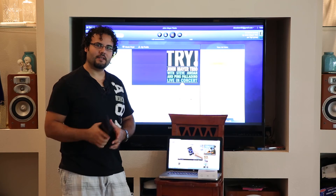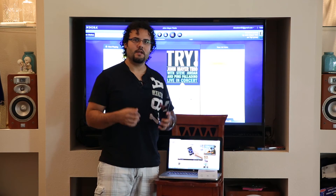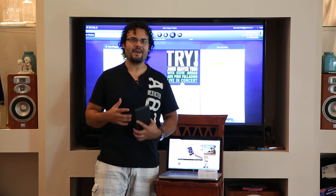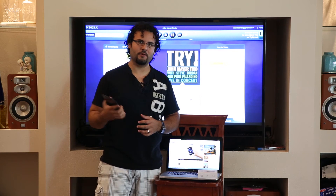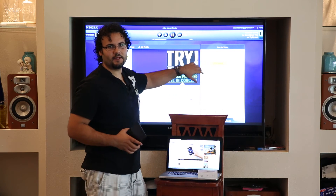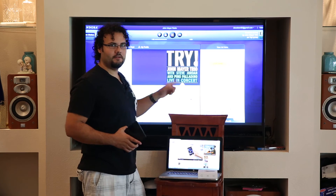Google brands the tab streaming as a beta, and it definitely is — I'd actually call it more of an alpha because it just didn't work very well for me. I also have a receiver with HDMI pass-through, so I can't plug the dongle into the receiver or I get no audio. Most newer receivers pass HDMI audio through fine, but for me I'm plugging directly into the TV and sending audio optically out from the TV into my receiver.